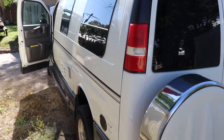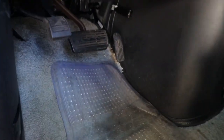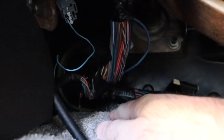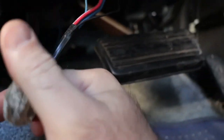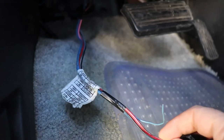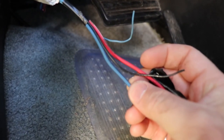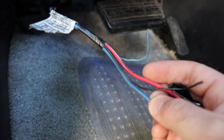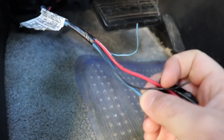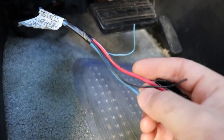On Chevy vehicles you'll find a clump of wires under the carpet that have the brakes preset, but they do not emerge where they're supposed to. These are labeled - that's going to be your stop lamp switch that's supposed to go out to the trailer. One is ground and one is power, and the colors switch back and forth: black is ground and red-white is the battery. We've got to keep an eye on that because we're going to switch from red to black in various locations.